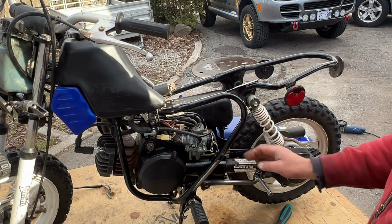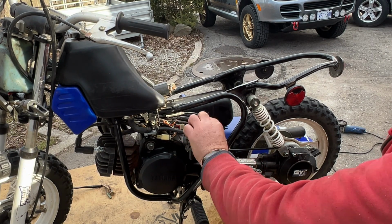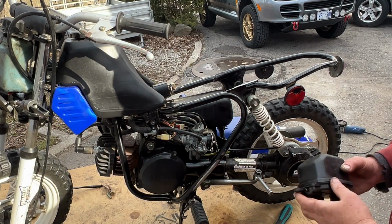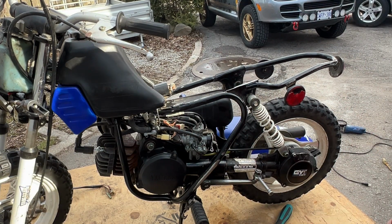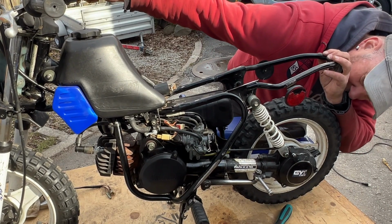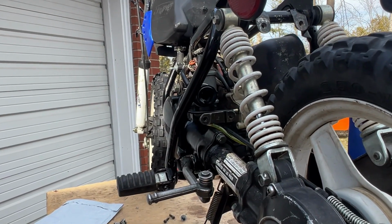So this is oil pump here. And that is an oil, I'm assuming the oil line goes there because it would be a vacuum feed. This doesn't seem long enough. Does it go around the bottom? Yes, it does. Yep. Air filter looks fine. Don't go falling off. So you can see the throttle inside there moving up and down. It's not stuck. It seems awfully far open. Let me get a light so you can see in there.